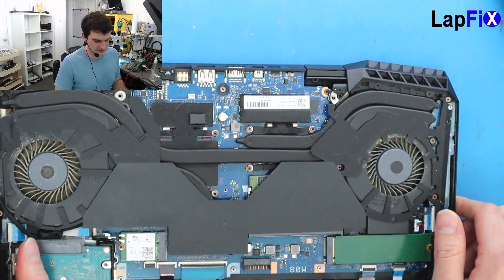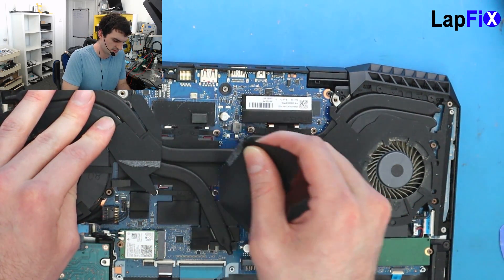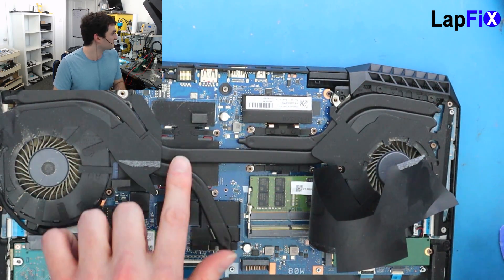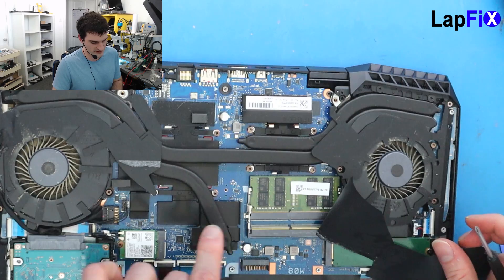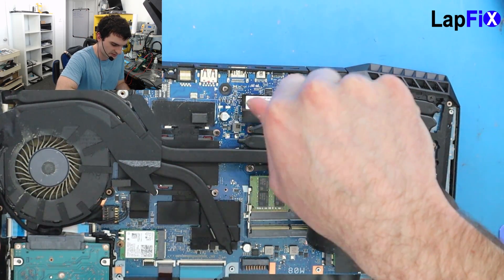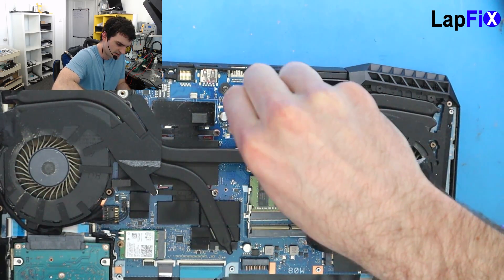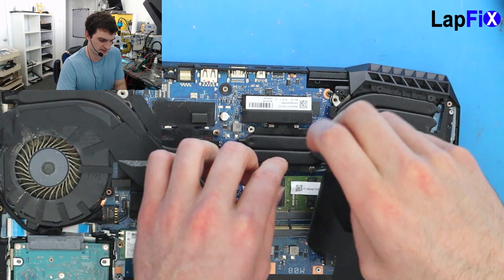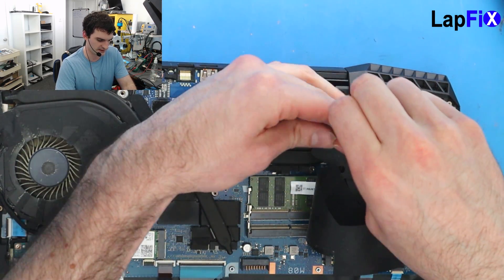The fans are really dusty. Now I just want to remove the heat sink. What I'm really aiming for is these two — you can see there's the graphics chip and the processor. I just want to remove the heat sink so I can get underneath and put the thermal paste on there. Now you're going to feel it's going to be pretty tight. I like to remove it in a diagonal direction just to ease the pressure off, and especially when I screw it back in.